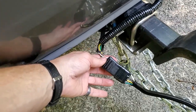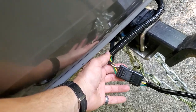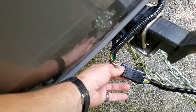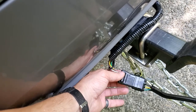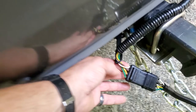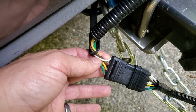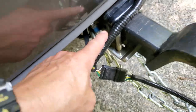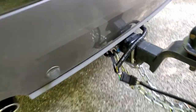Now of course you need to investigate the trailer wiring. I'm not going to go through all of this step by step, but these are just general things that you need to look for to determine what the problem is. So you need to look at your trailer wiring as far as the car's portion of it. Make sure there's no obvious problems with your wires. You might have to trace the wiring all through the bumper, especially if it's an aftermarket setup.